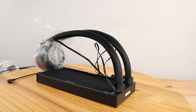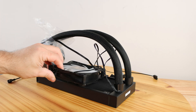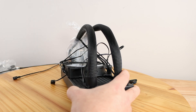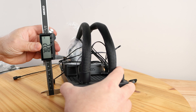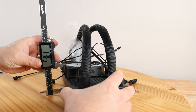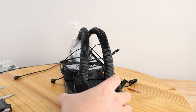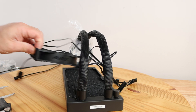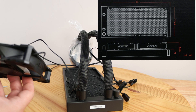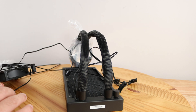When you throw a fan on the radiator, that's something we'll all be interested in. Measuring the combined thickness, it reads 54.84mm — the box states 54.5mm. I'm measuring from the thickest point; these rubber pads are a little higher, but you always want to measure from the highest point because you never know where the motherboard will be and it could become a real problem.